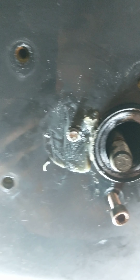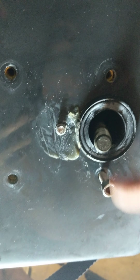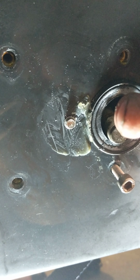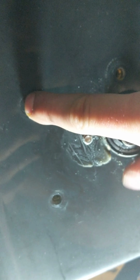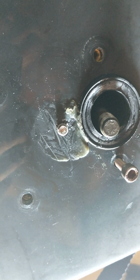But once you have, promise me this if you're going to do the job. I really would hate to see someone let this plate fall. There's a thread, I don't know if you see those threads back there, that's just a plate back there, and this is holding that plate there to hold it up. So when this thing is out, you can actually stick your finger in here and kind of hold it up too. So that's what I did. I eventually took that out as I swung the plate over, and now I had room to put my finger in here, and now I could rethread this one in the top left, and then I was able to install it flush, as you could tell on the other side.